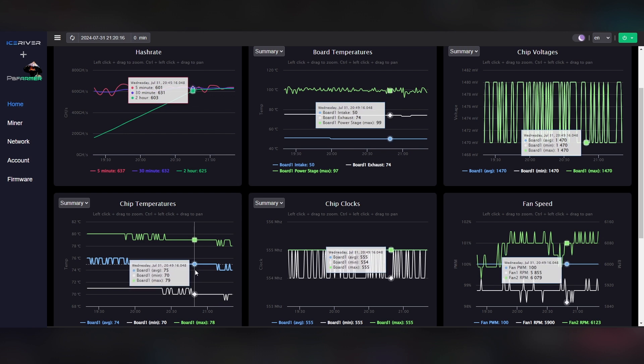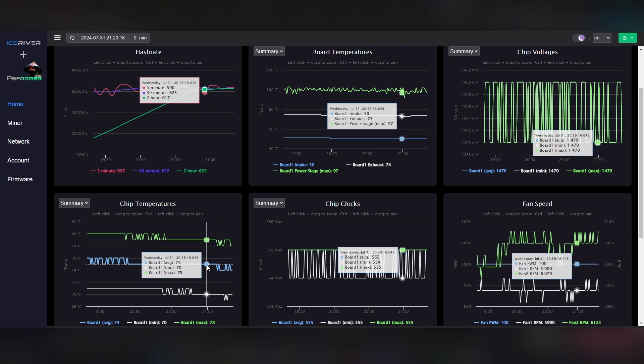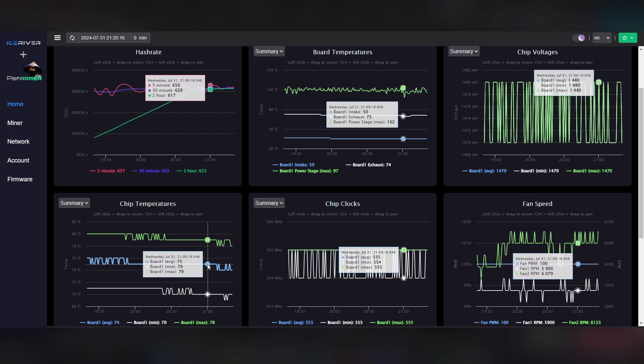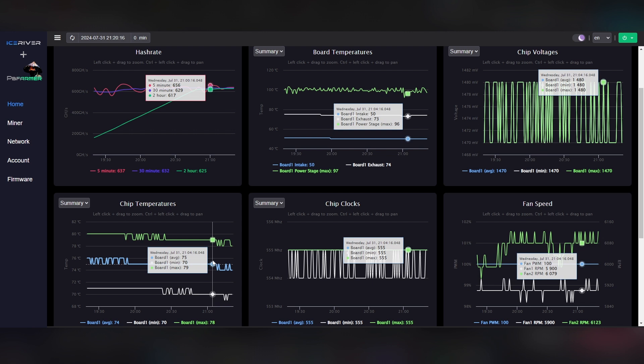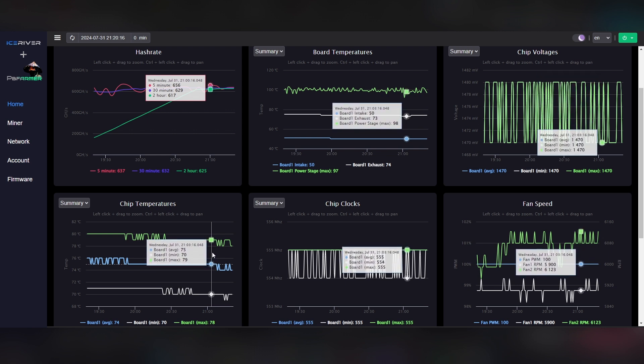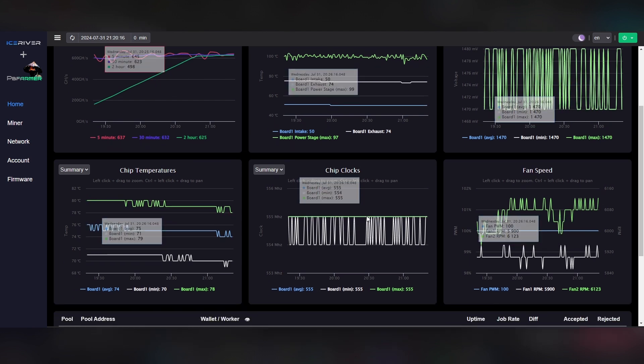Address these overclocks in the environment you're going to have the machine permanently — that way you don't have to worry about changing them later. Give yourself wiggle room: don't push it to the point where the thing's crashing all the time, because you'll lose mining time without knowing it. Don't sacrifice stability just to push an extra 50 gigahash. Watch it for a while in its permanent environment. As for voltage strategy: get the clock offset up first, then if it crashes bump the voltage a tiny bit, then bump the clocks up again until stable.